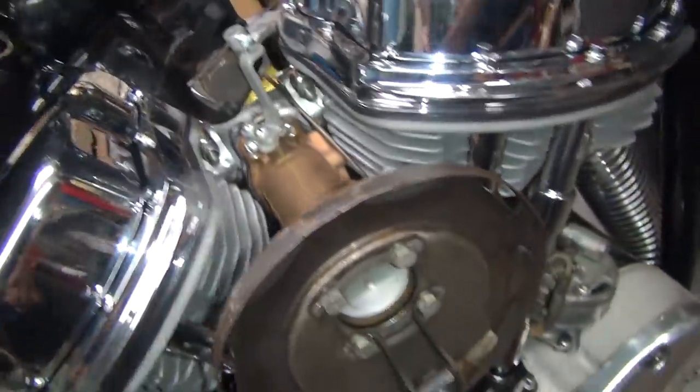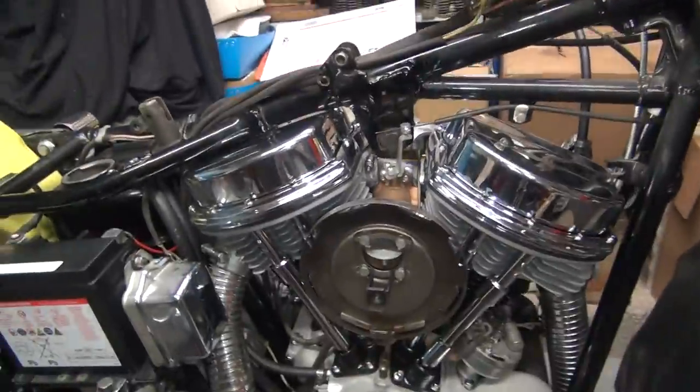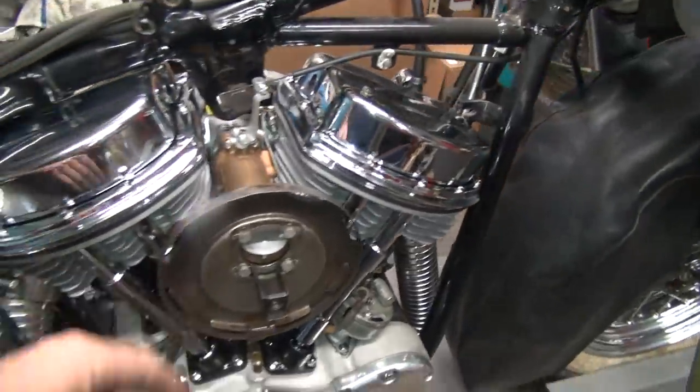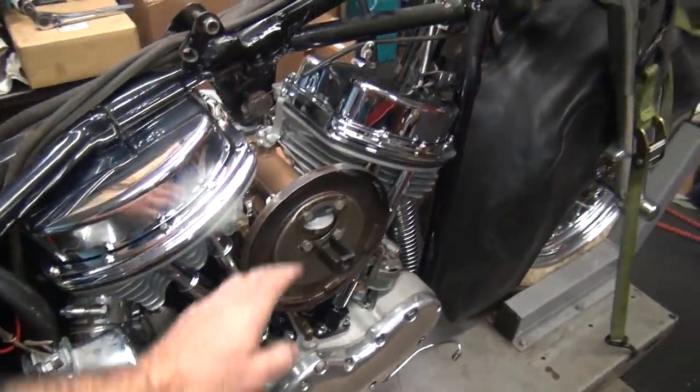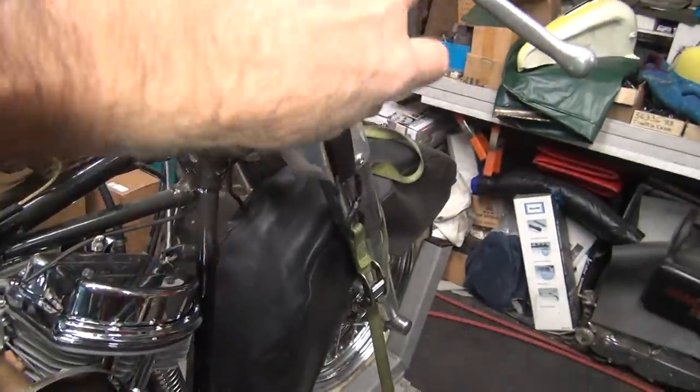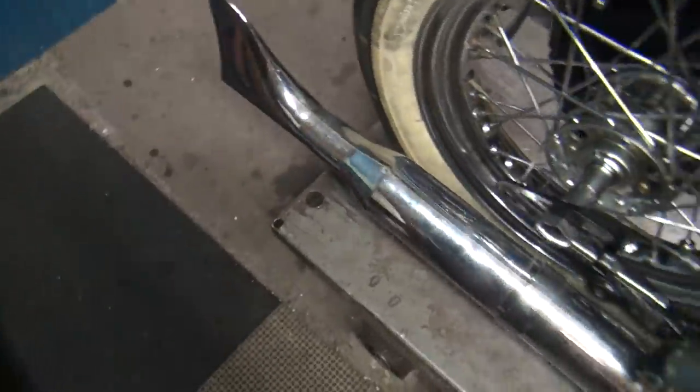Obviously got one lifter making a ton of noise. Stupid hydraulics. So basically I flooded it. I'm gonna give it three big kicks, fully choked. Choke full off, throttle wide open, and kicked it twice and a little... How's that? I think the bark's pretty loud.